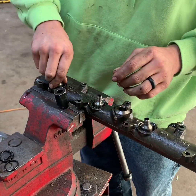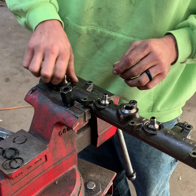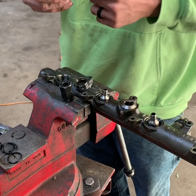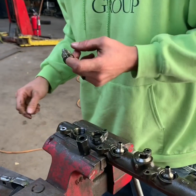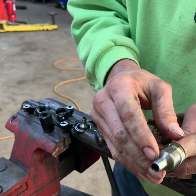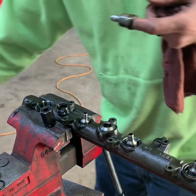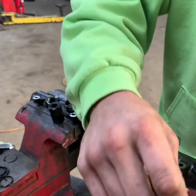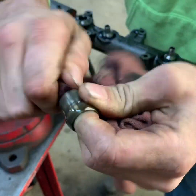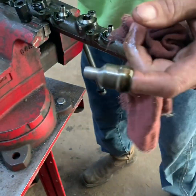When you get these out, you want to make sure the cups themselves are good. Unfortunately, we couldn't get cups on short notice, but we got the O-ring kit. If you look at this one, there are wear marks where the O-ring on the top of the injector rides. We want to clean that up because it's got a little bit of a ridge on it, so we'll just take a little emery cloth or scotch-brite and clean that up, get it all smooth again so it'll be a smooth surface on that O-ring and we don't have any tears.